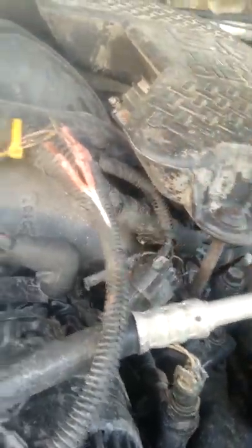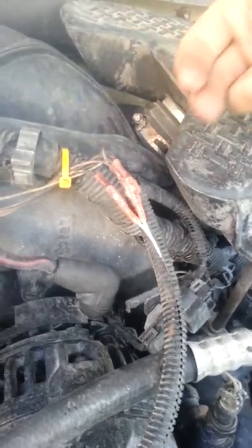Now it's a little hard to see, but that shouldn't be coated in oil. Like back here the EGR system part — it's clean. But if you look right there you can see oil. It shouldn't be there — not a good thing. This has got oil in it too, and this has got a little bit of a trace of oil, which tells me the turbo is possibly leaking oil. Not a good thing.